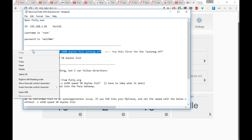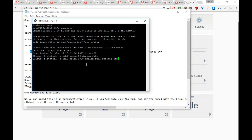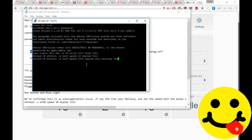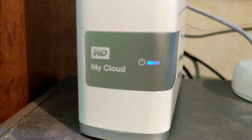Once that is accomplished, after the ticker drops to the next line, go ahead and disconnect your Ethernet port. Connect your My Cloud back up to your router, and after a minute or two you'll get that blue light indicating that you are now connected to Ethernet. You can see my cord there going back up to that fourth port on the back of the device, and now you've got green LEDs flashing there.